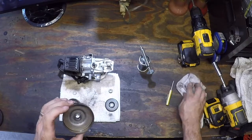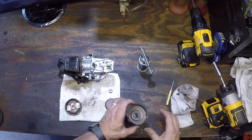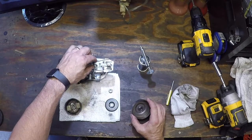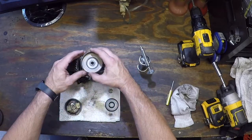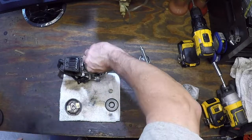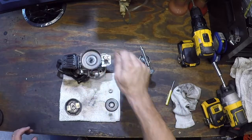The brake shoes — the clutch brake is sort of like the brakes on your car. They need to be clean and dry, get any oil out of them. They start to burn and discolor. And of course the washer and the drum itself, and the excess off the threads — you don't want that getting on any of the clutch surfaces.